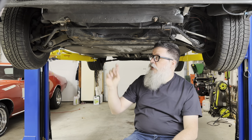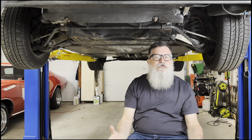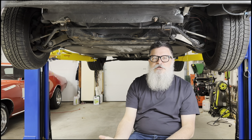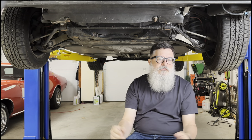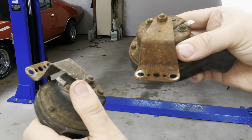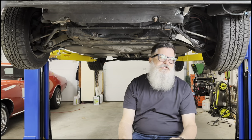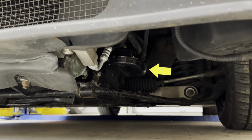The DeLorean has two horns, a high note and a low note. Neither of them worked. My first thought was something was probably wrong with the horn switch, or maybe in the wiring, or maybe just a fuse. But no, both of the horns were simply dead. I think I replaced these five or six years ago, and you can see how rusty they are already. This probably has something to do with the fact that they are mounted at one of the lowest points at the very front of the car.